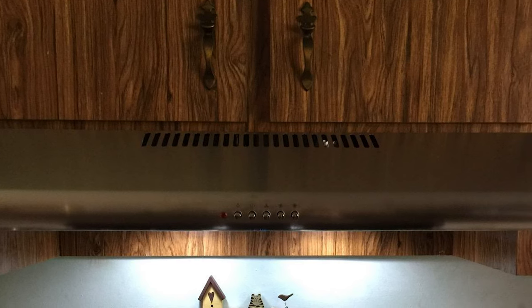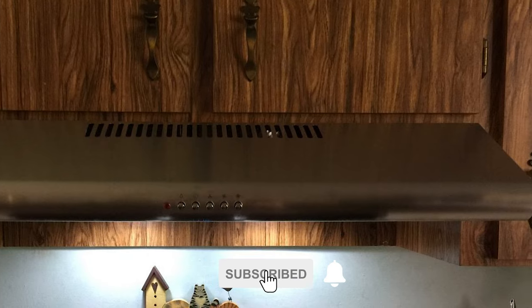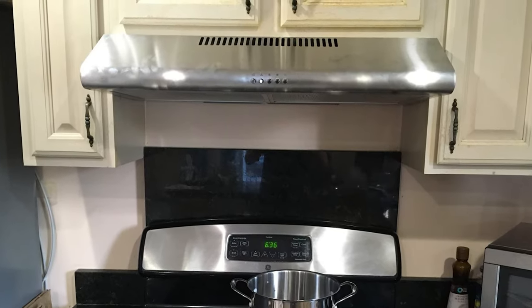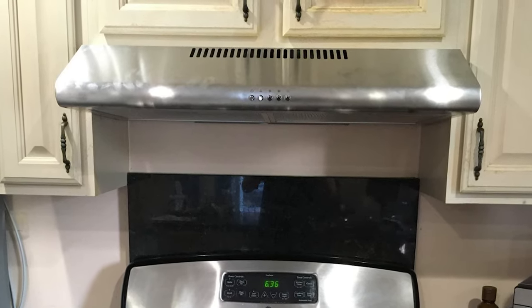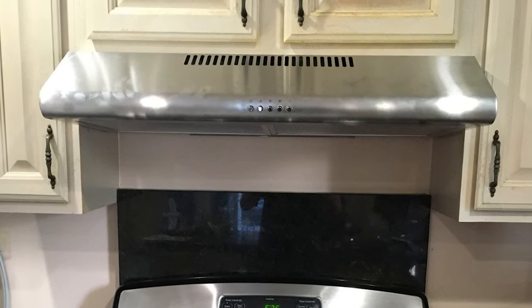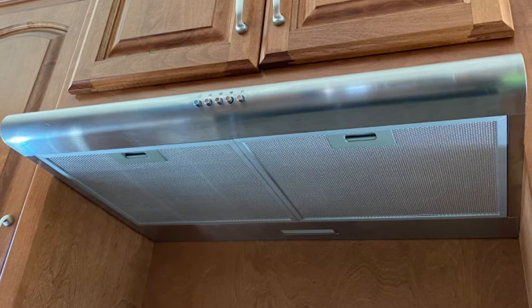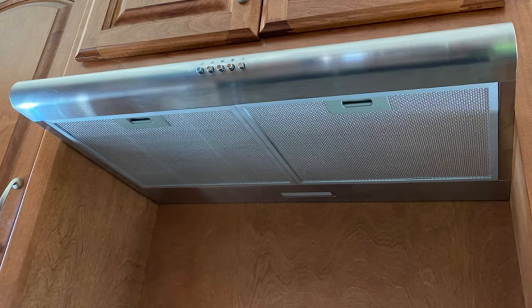This under-cabinet ductless range hood is built with cutting-edge technology and with the utmost care. Cosmo brings you beautiful premium range hoods at an affordable price. To run the recirculating setup, first switch the lever on the fan to the air recirculating mark — this makes the hood release air through the front gaps, not through the air duct. Then install the charcoal carbon filters for the fan. At top speed, the hood draws air at around 200 cubic feet per minute, which is sufficient power for a recirculation hood. If you're using more than one burner at once, this hood may leave some emissions behind.